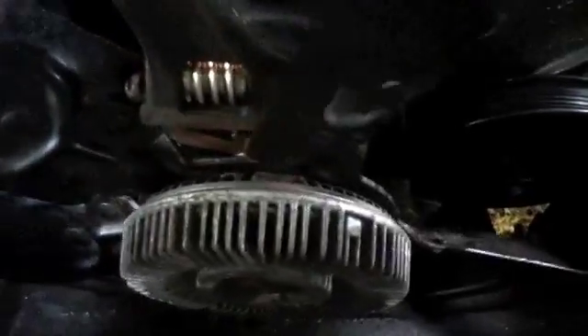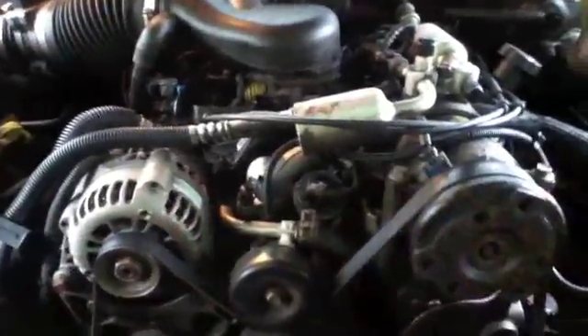So I got the fan off — I didn't pull it all the way off because I wanted to show you this. You just take the adjustable wrench, slide it on there. The pulleys and everything will move when you hit it, but you just give it a good whack. You might have to do it a couple times just in case you miss. Once you give it the good whack it will fall all the way down — that is how you know it is off. You just pull the wrench off, spin the fan, and that nut backs off. That nut didn't move before, but now it is backing off.